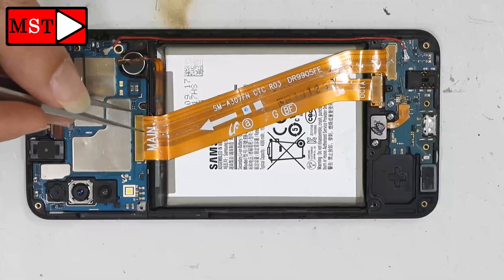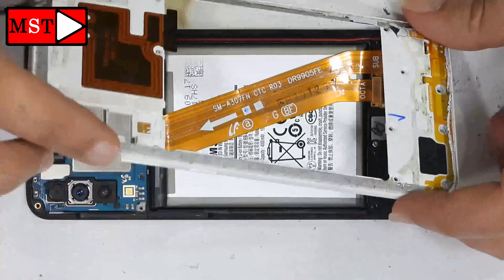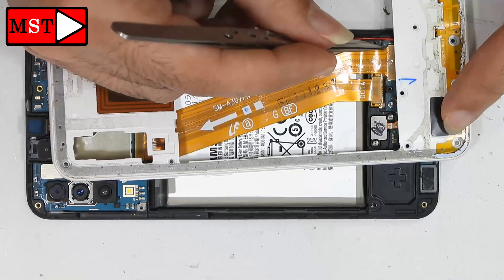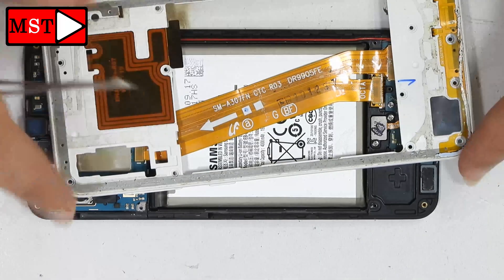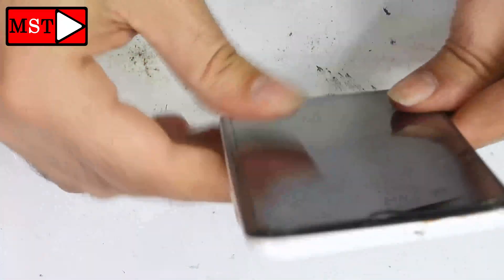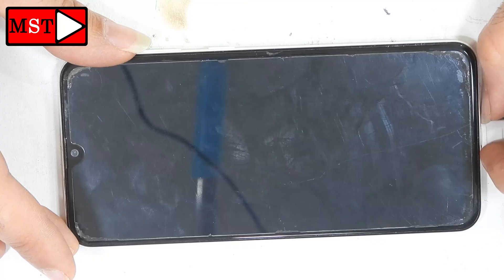When putting the white frame down, pressing it and tightening the screws could cut that wire, so make sure there is a gap and don't force it against the wire line. Check it visually — I can't tell you exactly what to do for your specific device, but walking the wire along the flex cable path and securing it there is the best approach. Let's put it down and test. Everything has been covered — if you have any questions leave them in the comments below. Thank you for watching, and don't forget to like and subscribe to support the channel.